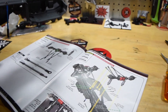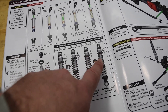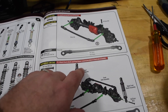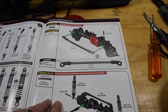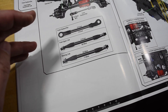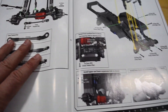I'm moving on to the rear axle and rear links. Before I do, I'll show a couple of things. The shocks have suggested height adjustments, and there are different springs for the front and rear — the rear shocks have an orange stripe and the front shocks have a white stripe. The manual shows the actual one-to-one size of each link so you can compare. One of the trickiest sections is the panhard upper link and steering link — they all look similar but are slightly different, especially the ball joint sizes on the steering link versus the front upper link.